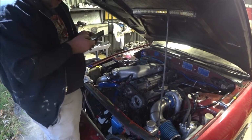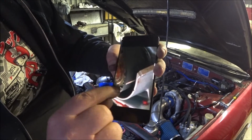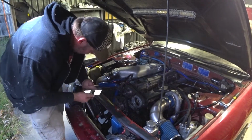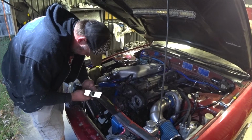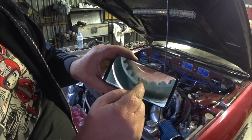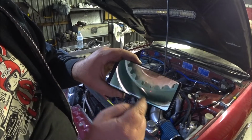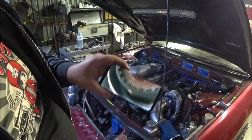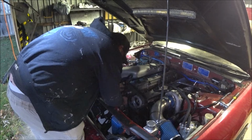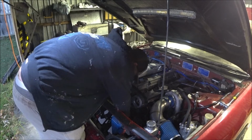It doesn't show it. So you can see the line on the belt, and you can see the timing mark on the oil pump, but you can't actually see the mark on the sprocket. So I can with my eye, but not in that photo. Okay, what you can see, you can see the line there and the mark there, so that's the tooth there, and that's where the belt sits in it, either side, the lines between them, so it sits over the mark that is meant. Let's just push it on now. Should be the easy bit.